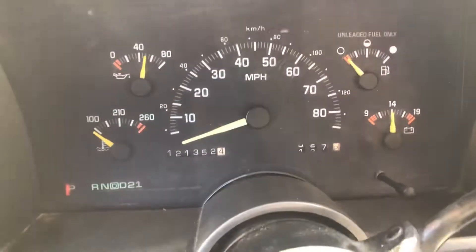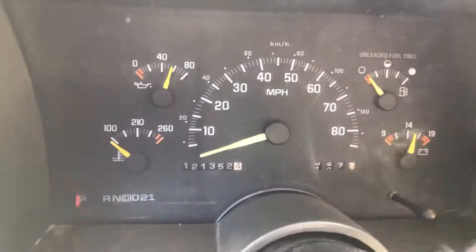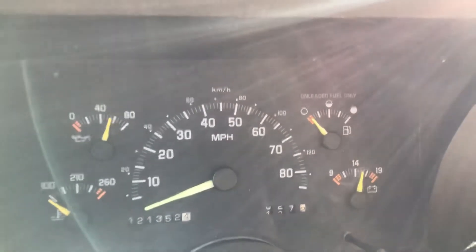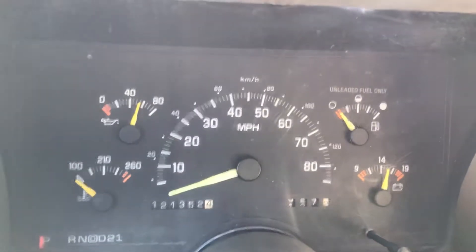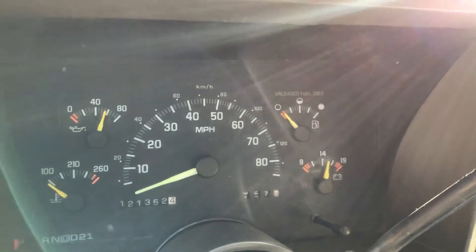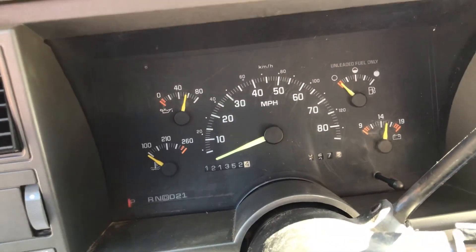Before the fix, all the gauges would be jumping, voltage would drop to nine, and my engine would cut off. So check to see if those ground straps are broken, or if you just want to give yourself an upgrade, do it — the upgrade costs about fifteen dollars for the zero gauge wire. I used about 10 feet of ground wire. I'll write down my measurements so you can have the same thing. If you have any questions just leave a comment and I'll try my best to get back to you.